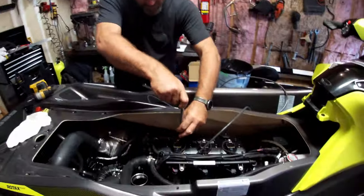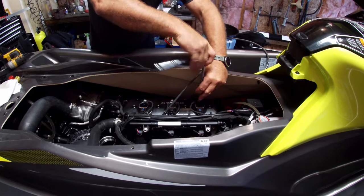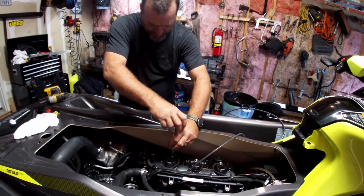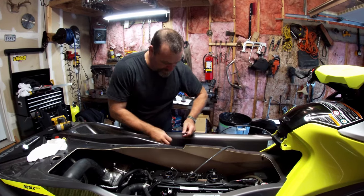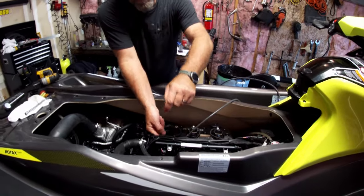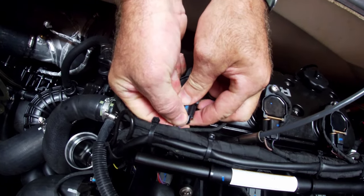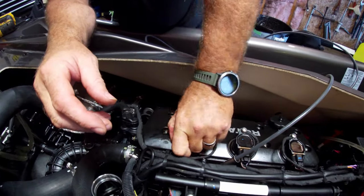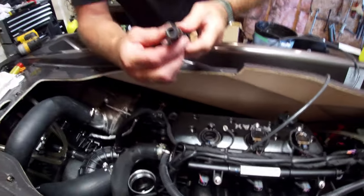While the oil is still pulling, we're going to get the coils out so we can remove the spark plugs and get some fogging oil in there. Don't drop the stainless steel screws in the hull — you can't even pick them up with a magnet. Release the clip on the coil and push it up and out of the way. Work the coils up slowly because the bottom rubbers will stay on the spark plug if you get too aggressive. We got them both — one, two.